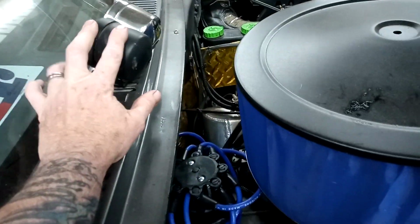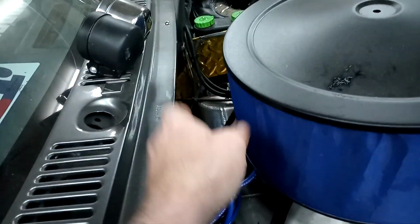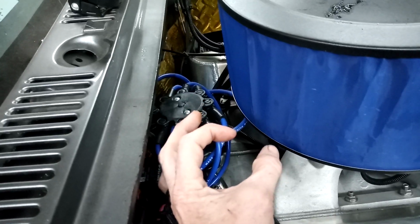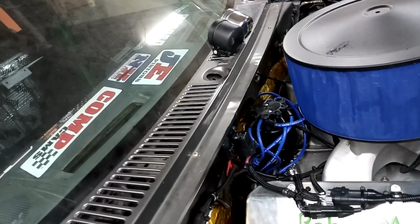And then I've got, of course, an Autometer oil-filled fuel pressure gauge here that goes to 100 psi, but I've got 2 of those small ones. They're made by Marshall. I'm going to put one here, and then I'm going to put one back at the fuel pump. And the way we're going to do the fuel pump is a -10 line going into it.